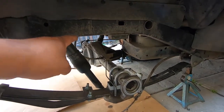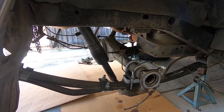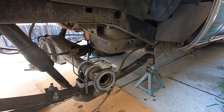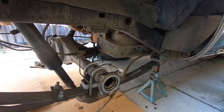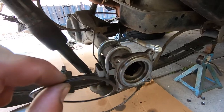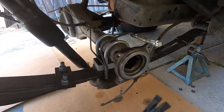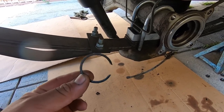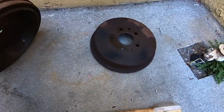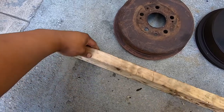That side of the axle seal was leaking bad, so we decided to pull both axles out and replace the seals and bearings. Basically all you do is you get the 14 millimeter right here, undo both the brake line from the brake cylinder, and you pull the whole axle out. Then there's this o-ring that goes here — you remove that, this one's flat. We already pulled these out; we just used the hammer for that. This clip comes off of the axle and these are the drums — this is the driver's side, the one that was leaking. You can see how bad it is.